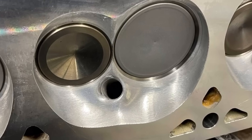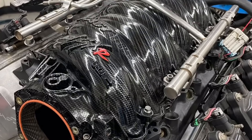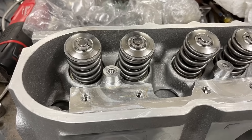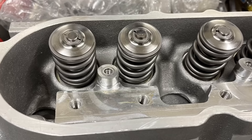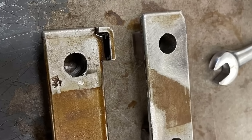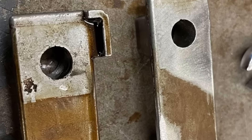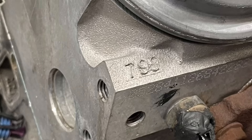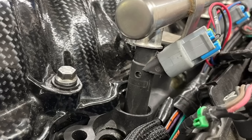The TFS heads were combined with a port-matched FAST LSXR intake manifold that had a cool carbon fiber dip or wrap, and also combined with a 102-millimeter FAST Big Mouth throttle body. The Trick Flow heads were treated to an Ultimate RPM spring package which combines a 685 spring and a minus-45 retainer to increase the spring pressure and RPM potential. Installation of the Trick Flow heads required removal of the locating tabs on the factory rocker stands. As luck would have it, milling the heads 30 thousandths allowed us to utilize the same 7.425-inch length pushrod used with the 799 heads. After modifying the rocker stands, we installed the factory rockers and then installed the 80-pound injectors in our stock fuel rail.